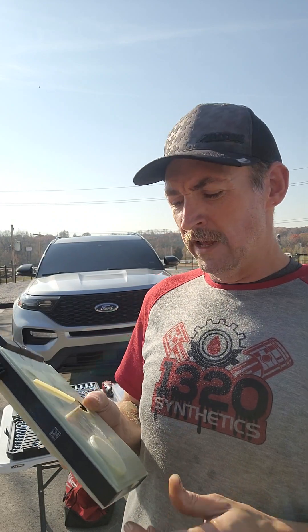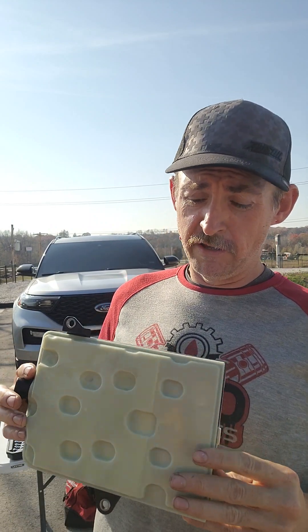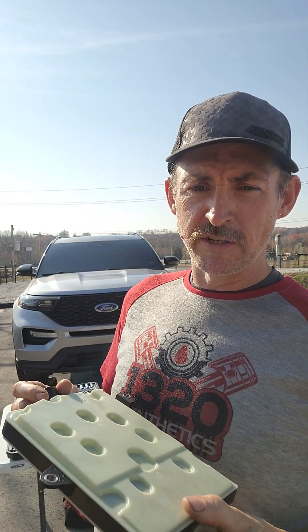This filter does need to be serviced — we recommend it every 50,000 miles with the fluid, even if you have a PPE pan. These filters typically only filter down to about 100 to 200 micron because they're suction filters that have to be high flow, so filtration efficiency is not like an oil filter at around 20 micron. For comparison, a human hair is 100 micron thick and a red blood cell is 5 micron — so this isn't capturing very much. Service this regularly — it's cheap insurance.